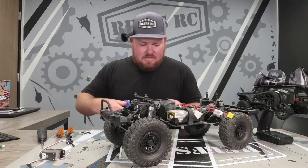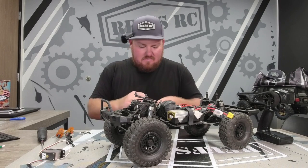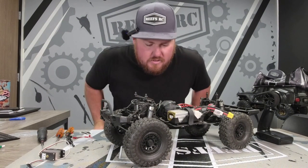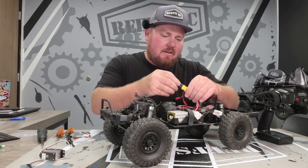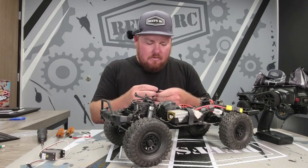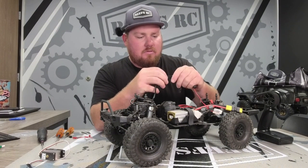Let's get this BEC installed. I grabbed one of our dual JST-XT60 battery connectors. The nice part about this is we're only going to use one, so if you wanted to run lights in a rig you could run those as well. We're going to plug this in here, and then we're going to take apart our EZ BEC right here. So you're going to disconnect your servo - black to black, gray to gray - plugs in, boom.